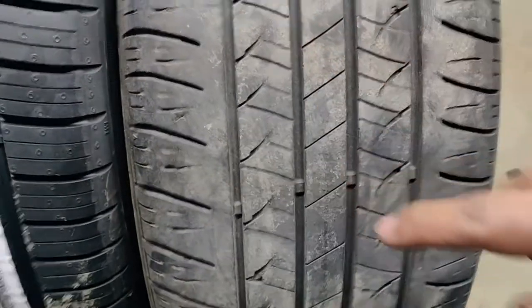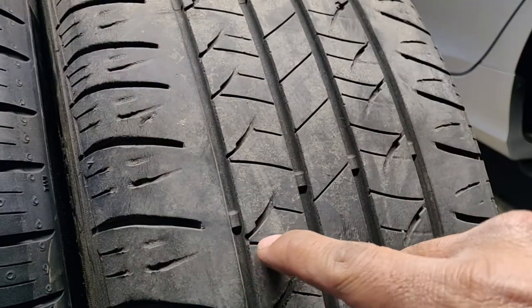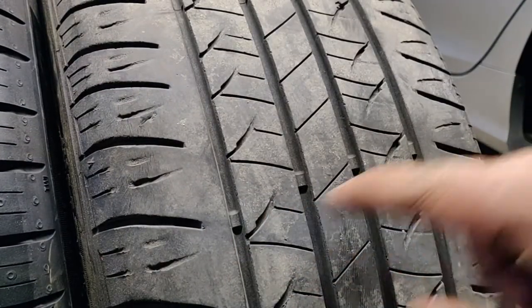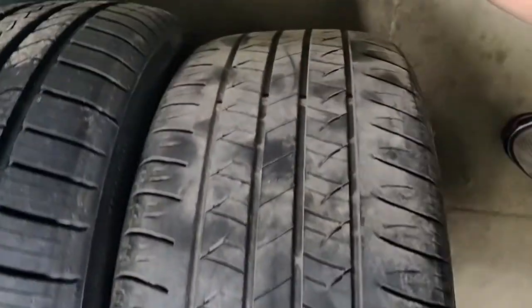That's the tread. And that right there, see that block of rubber that runs perpendicular to it, that's the wear indicator bar. See how the tread is not at the same height as the bar right now? That means there's still some good tread left on it. So that was the indicator bar. That was one spot on the tire. Let's see where the other spot is, right there. And as you can see, there's a bit of a distance between the two. And that distance between 2 different wear indicator bars is different for different tires. Some tires, it's really close, some tires it's far away.